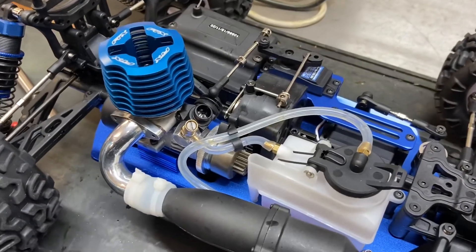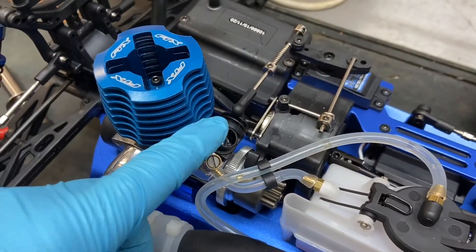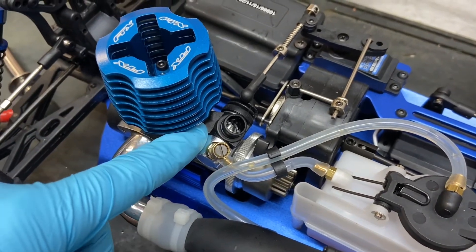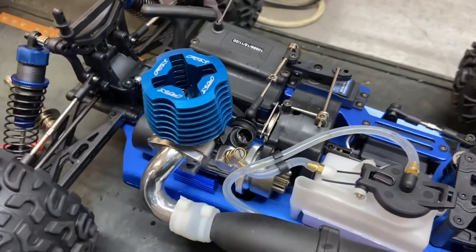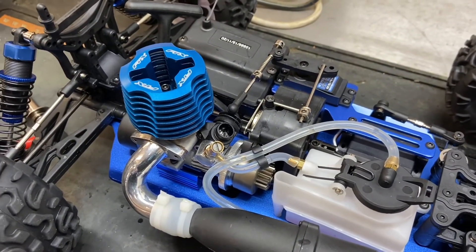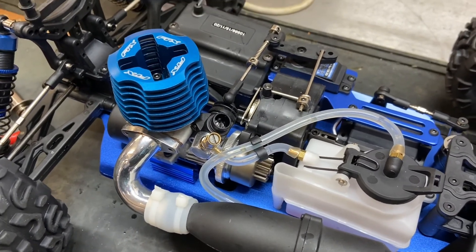Don't try to stop the car moving by applying the brakes at high idle — you'll melt your clutch. Get your 2mm gap set, then start it up and finish your idle setting from there. If it's revving too high, turn the screw to the left gradually and the revs will decrease; revving too low, turn it to the right and the revs will increase. Those are your base settings — you're ready to start your car. We'll do that in part two. If you've got any questions, feel free to comment, like, subscribe, or leave any tips on how I could make it better. Thanks a lot.